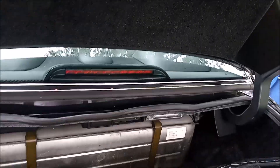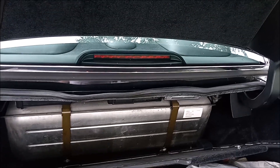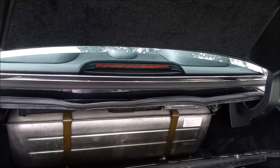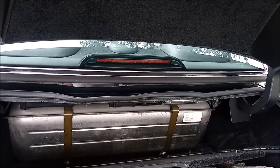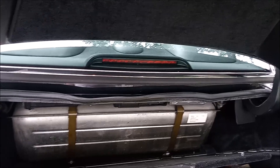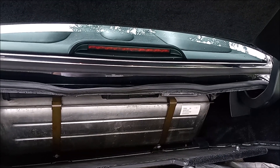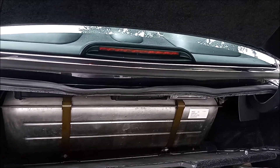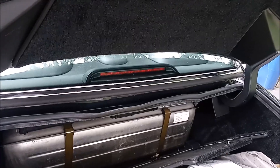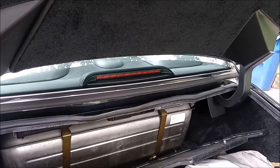This part I did see on the Internet and I do believe it. Before you even begin working on the springs, after you have identified their location, the next step — really the most important step — is to release the pressure from the system. You do that underneath the car, because if you tried to do it here it would spray out and create a big mess in the trunk. So you release the pressure from the valve under the car, and I'm going to hopefully show that to you in a second. But once the pressure is released, you can start to take those gas springs out and replace them with the new ones.